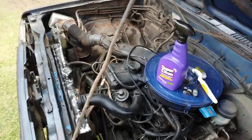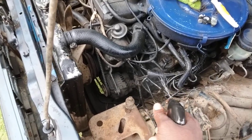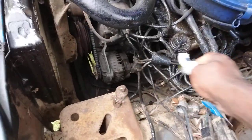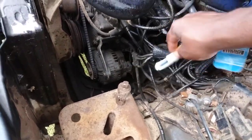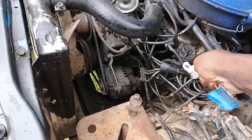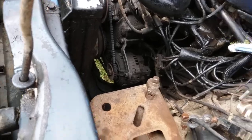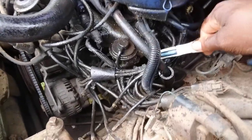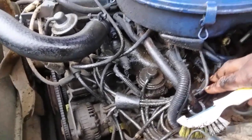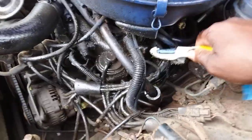Alright, what we're gonna do is put a rag down here and get those vacuum pipes. I got to pull all these off when I change that carburetor. Using the Super Clean scrub stuff, take the brush and hit these vacuum hoses, clean up some of that crud that's on them. That thing is dirty — feels like this air system is new once you clean it up.